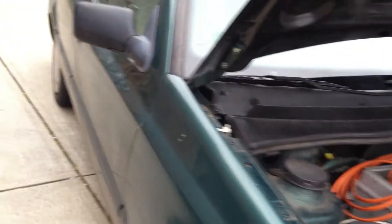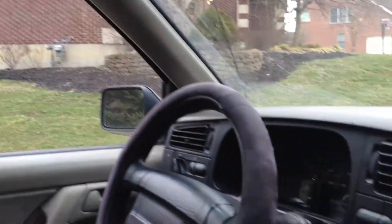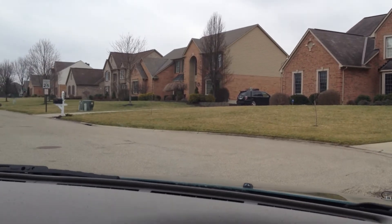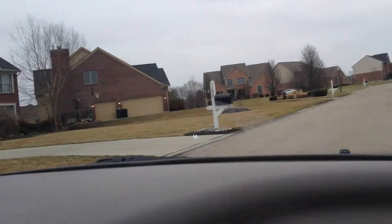So that's the car — those are the details. Let's do a quick drive and I'll show you what it looks like and feels like driving down the road. When I start off the car, it's always ready to drive. I can start in third gear because an electric motor, unlike an engine, has full torque right from the beginning. So I really only use third and fourth gear. Let's go ahead and hit the gas pedal. You can tell it's pretty quiet, as you'd expect. When I shift, I can simply pull it out and push it into another gear and it just shifts that easy.